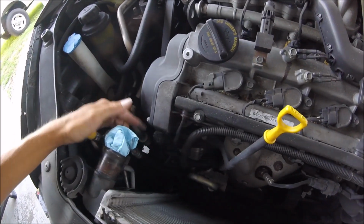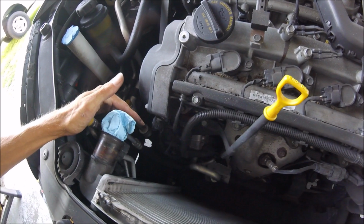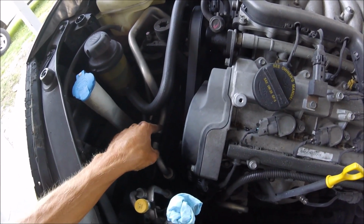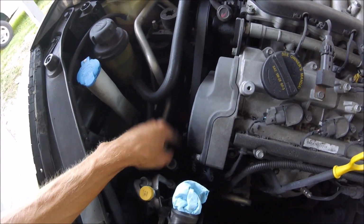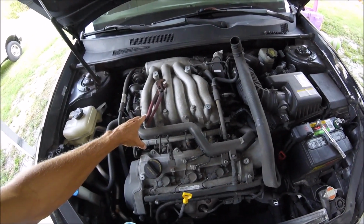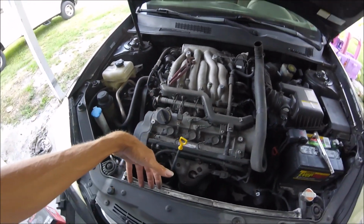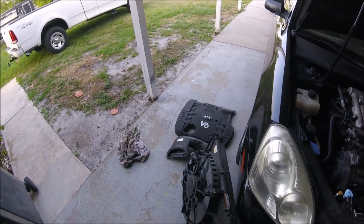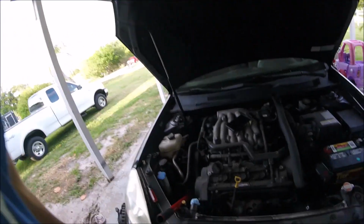So I'm going to go ahead and disconnect everything for the alternator and probably pop off the belt, so that way I can take the alternator out once I get the bolts out that are holding it. Everything to this point has been a 10mm. All these for the engine cover, and then to hold the fan and intake on, all the bolts have been 10mm bolts. Pretty simple.